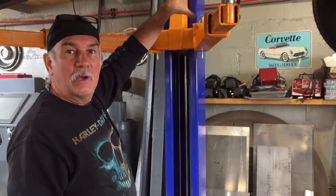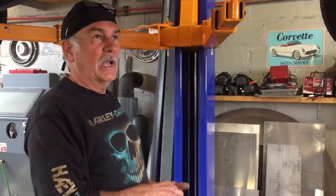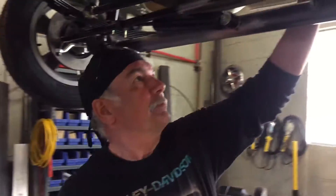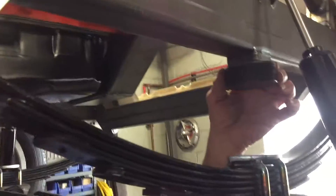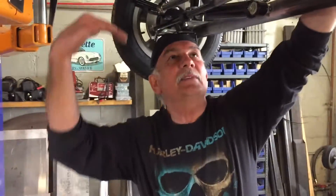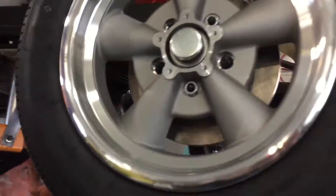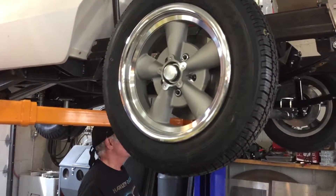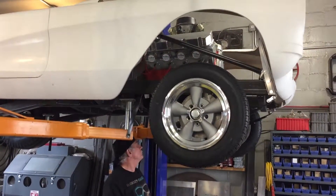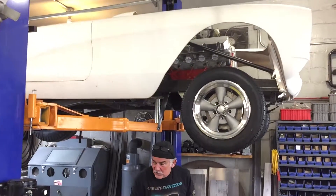The mufflers will hang down a bit for cooling, and we have the height anyway with the straight axle — the gasser look typically sits up. Here are the front bump stoppers, the same style — they'll bolt down here. The reason it doesn't line up exactly yet is because you're working with an arch spring, and as that flattens the spring lengthens and then it will line up. All the steering linkage is in; I kept all the control rods straight, used a small GM steering box with an offset in the pitman arm, and a hot rod column at the factory location.